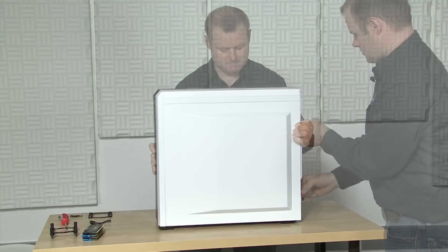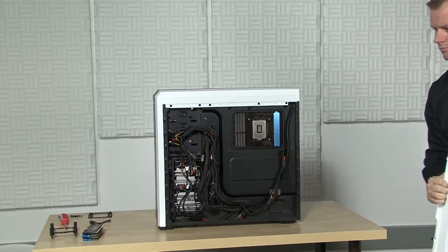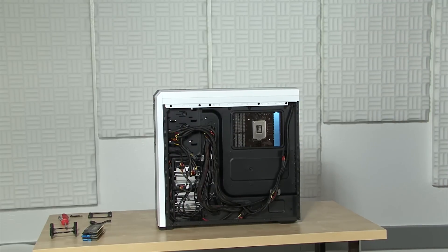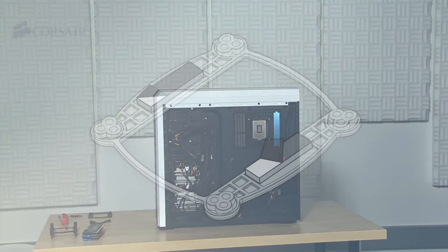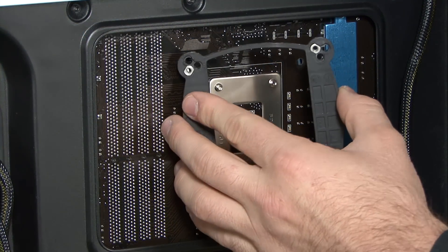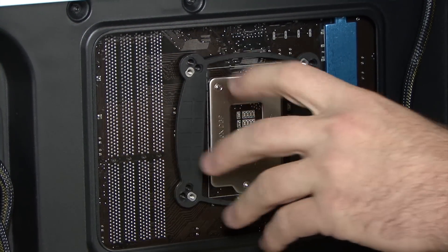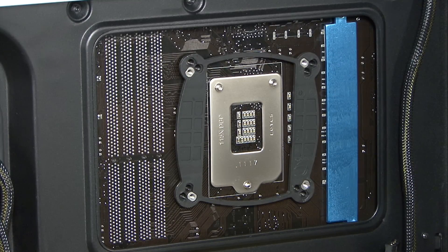The Carbide Series 500R has an easy-to-remove side panel. The CPU backplate cutout lets you install CPU coolers without going through the hassle of removing the motherboard from the case. Assemble the backplate based on your motherboard chipset. For LGA2011 motherboards, you can skip this step. Now that I've got the backplate assembled, I'm going to attach it to the back of the motherboard, making sure I rotate the standoffs to the correct orientation for the motherboard's mounting holes. For AMD systems, this step is unnecessary as the holes only line up one way.